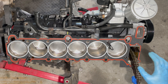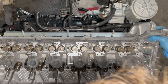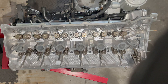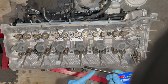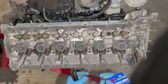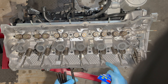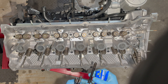Once the head gasket is down and RTV is in place, we're going to go ahead and place the head on top. At this point the ARP studs only go one way — as you can see there's a bevel on the bottom, so that goes block-side down so you can get the Allen key on top. I put assembly lube on the bottom and I clean these prior. Before putting the head on I actually thread them into the block to clean out the threads, because you don't want a false torque reading and you obviously don't want to snap anything.